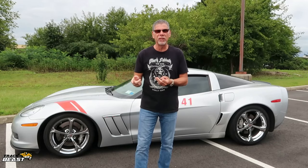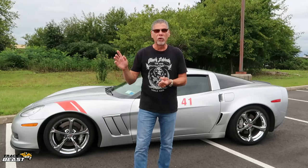So I bought a pair of Hawk 70s with me and I replaced them, as you can see in one of the videos. I replaced them and I did about 5 laps and my foot went to the floor and I went off the track. So I ended up boiling the fluid because it generated so much heat from the Hawk 70s. Since then, I upgraded the brake fluid to Motul 660, and I also upgraded the brakes.